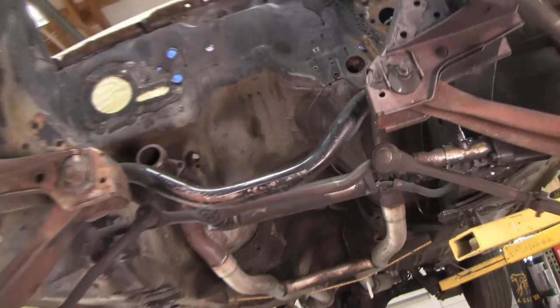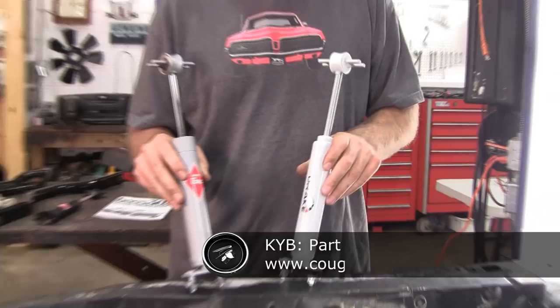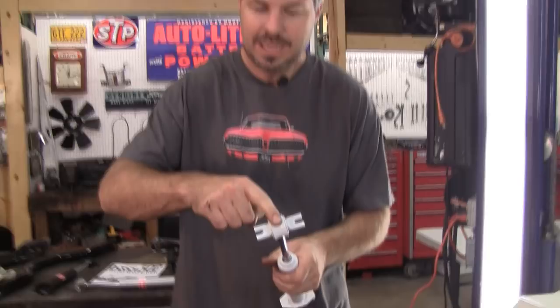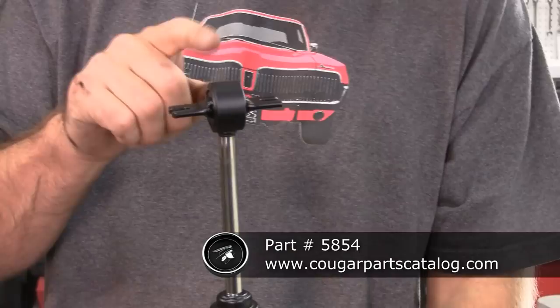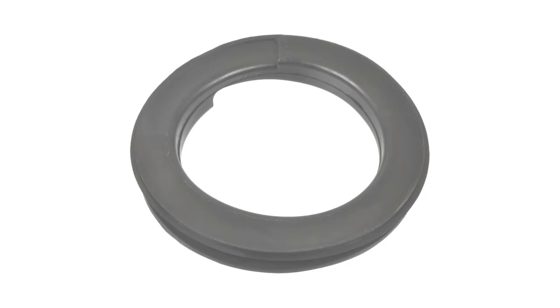Performance shocks are another big bang for the buck in my opinion. There's the old standby KYB gas-adjust shocks — I've been selling the Scott Drake version of the KYB shock for some time and I've been quite happy with the performance. Although when you're looking for a stock look under your hood, that is not a stock look or color. This KYB Excel shock, on the other hand, is the right color of black and the right configuration. So if you're not looking for top-notch performance, I think these are a good replacement shock. A lot of guys like polyurethane — I don't. They squeak, they don't look right. I'm not racing my car, so I like stock soft bushings. They do the job.